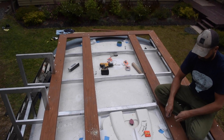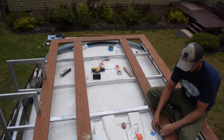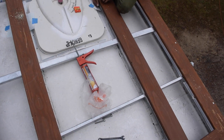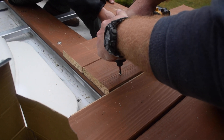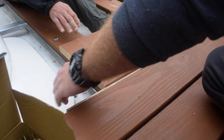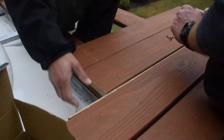To attach the wood, we laid down a row of boards first on top of the metal frame, then screwed into that wood to create the final deck boards. This is close to how a house is built with a foundation sill plate and subfloor. This method also limited the cost and number of bolts needed to finish the project.